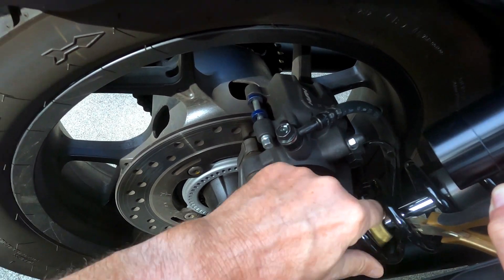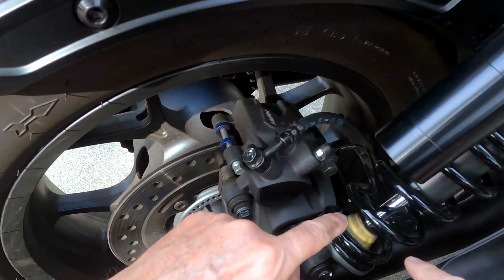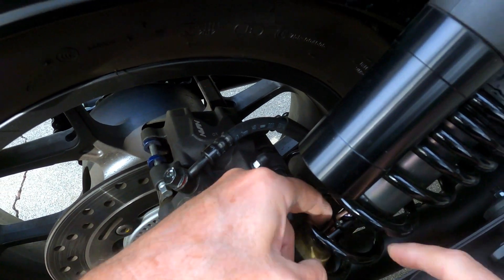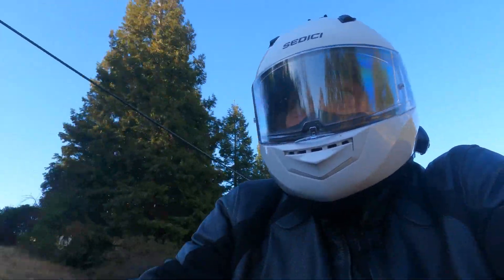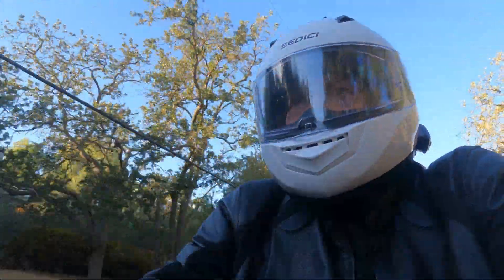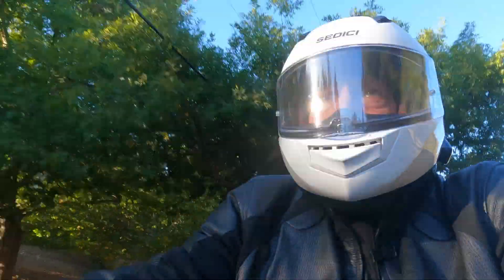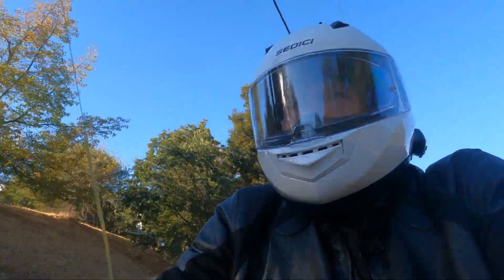So what did I learn? I found out that for somebody my weight, my front shocks have more than enough travel to avoid bottoming out because of exaggerated bumps in the road. However, my rear shocks needed to be stiffer. In technical jargon, I needed to increase the rear shocks' preload. Increasing the rear shocks' preload will lessen the frequency of bottoming out, keeping your kidneys content and helping your buns stay parked on the saddle.